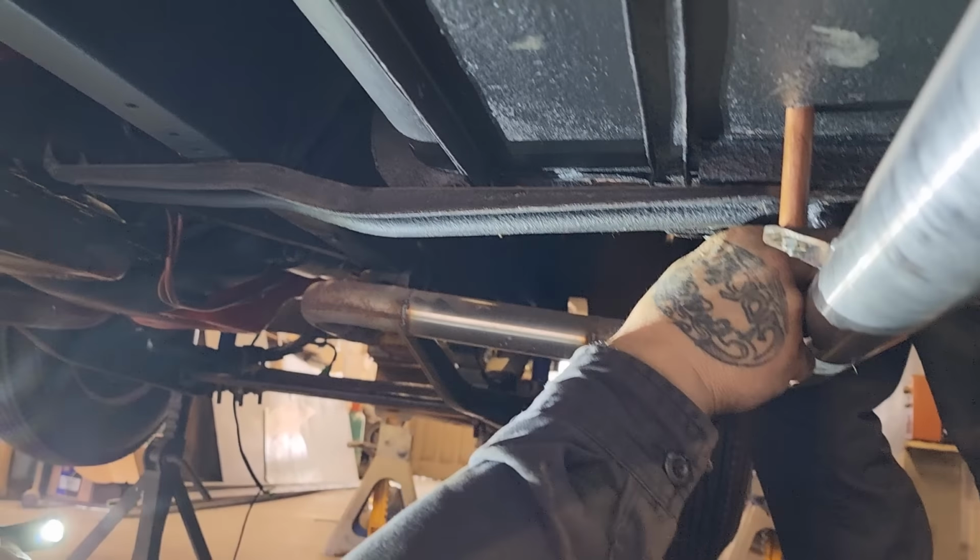Okay. I got a little buckle up underneath there. I didn't really notice. Oh, right there, yeah. Use your gloves and pull that out or something. We got that one welded up. Now that's got that. I should be able to put that spacer in there now. That slides up in behind with the threads. We are probably half an inch off from the alternator to the side fender, and that's just right.